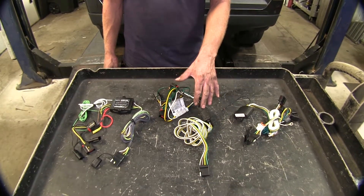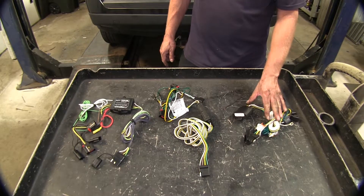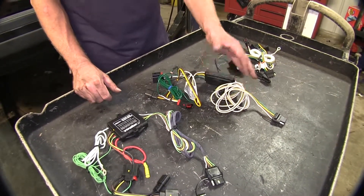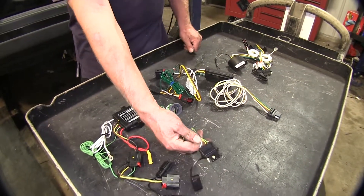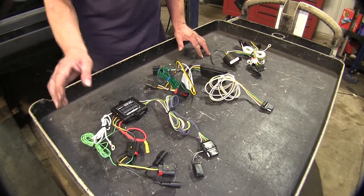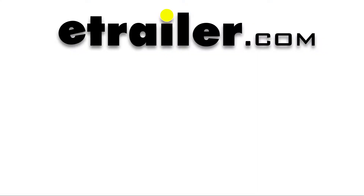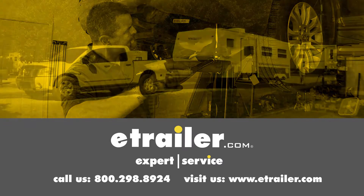There's a little difference between the running light circuit and turn signal circuits on the Curt. The Tekonsha is back up to 15 amps. If you're just going to run simple taillights and two running lights, the Curt is all you need. If you're going to run something more — like switching to a seven-pole or six-pole connector with more lights — the Hopkins or the Tekonsha will be rated for more of those purposes. That'll finish it for the best wiring options for our Jeep Patriot. Click the link below to shop, learn more, or visit us at eTrailer.com.